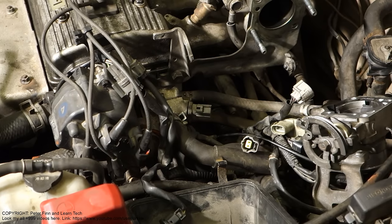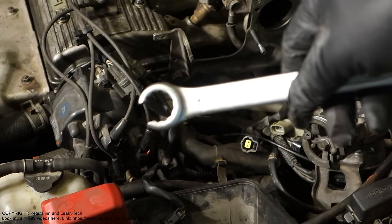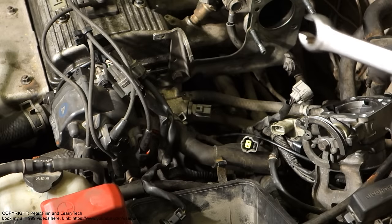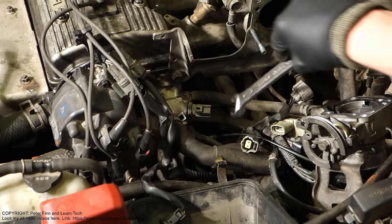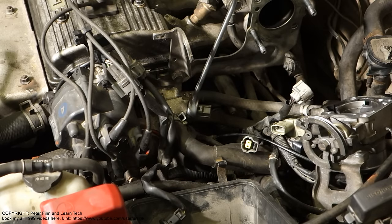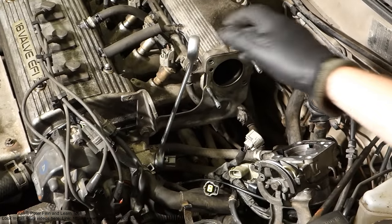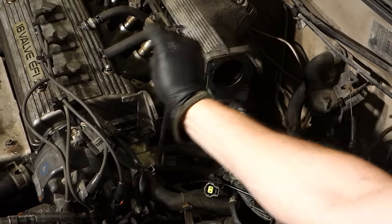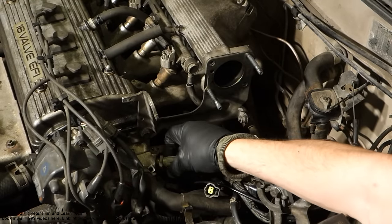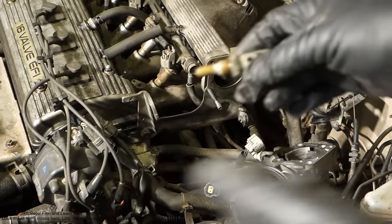Okay, and when I am planning to take that sensor out, I need a wrench that is size 19, 19. And if we have that kind of wrench, it fits in here really nicely in that position. Then I only take my hand in here, and this sensor opens easily, and then I rotate that in here, and there is the sensor. It looks like this.